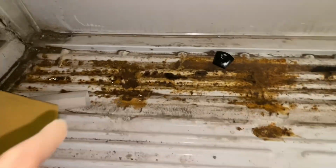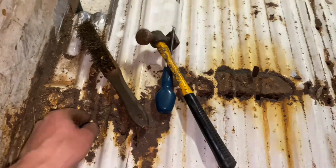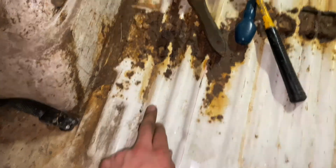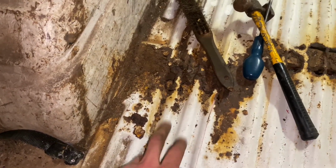So moving on to the rest of the van. The rest of the floor is actually reasonable, not too bad. We'll need a few repairs in here, a bit of daylight coming through, and this bit just here, there's a cross member that runs along here. Basically anywhere there's a cross member, it seems to have started going a bit, just where the spot welds are. And I believe there is, in here, there's a big sort of spring mount plate. They tend to go as well, so we'll see what it's like once we've cut this top section of the floor out. Might have to make a kind of spring mounting point there, and probably the same at this side as well. Doesn't seem to be too bad.